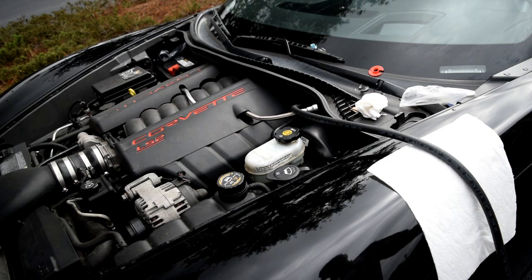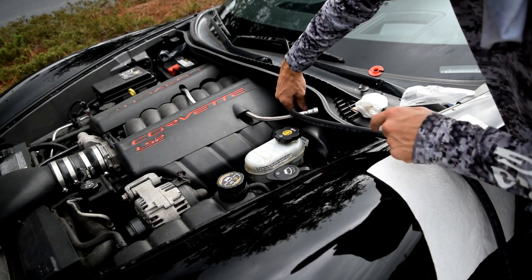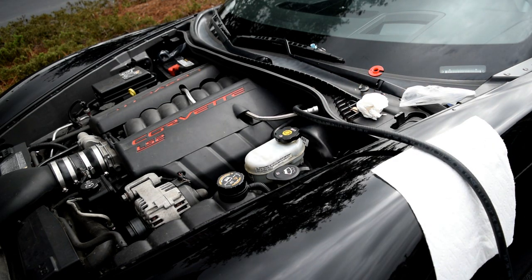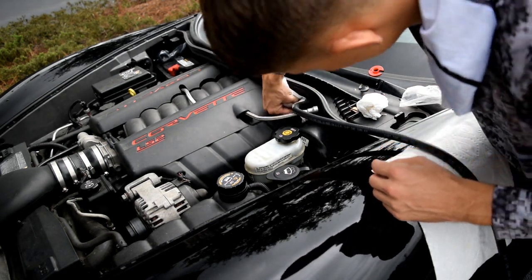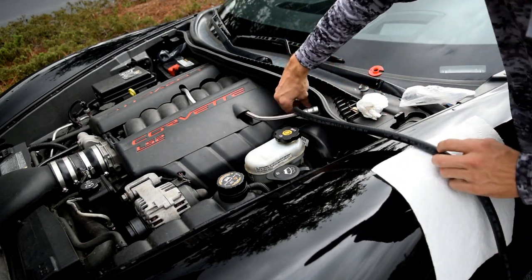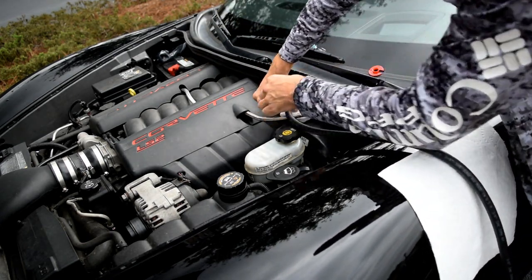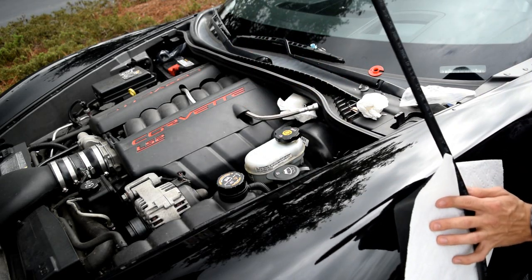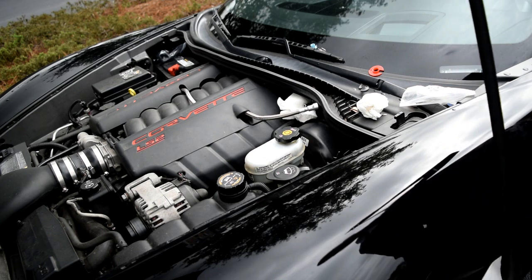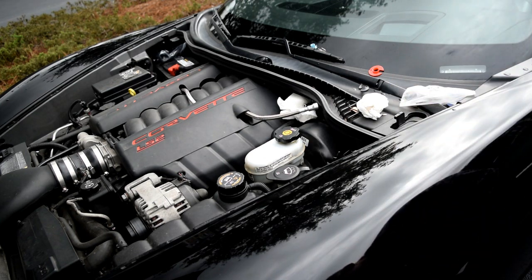And at this point, you can also go ahead and disconnect the hose. When you pull this off, it's gonna leak some more gas. So get some paper towels handy. You wanna keep the other end still in the bucket. You can pinch the tube to help a little bit. Raise the tube up so that all the fuel in it will run down into the gas can. There we go. And then set that aside.